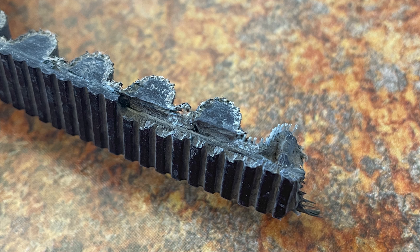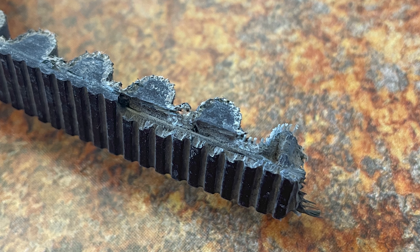As you damaged several of those cords, you were operating on fewer cords. Days later, when you were putting in all that torque — going up singletrack, you're a decently strong human with gear on your bike — you weren't operating on the full dozen cords, you might have been operating on half of them. So the belt just didn't have its original strength anymore. That's why we see that stepped or jagged break — it shows that some of the outside cords were damaged from the roll-on. Then your belt broke, and that's a horrible experience.